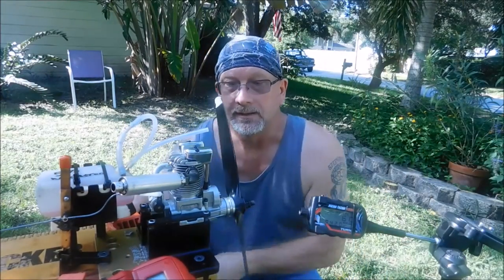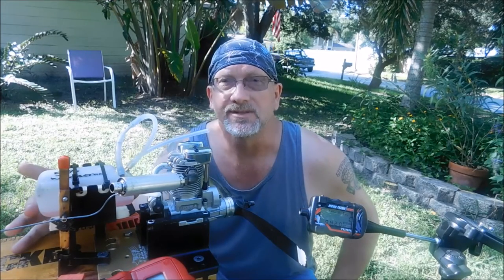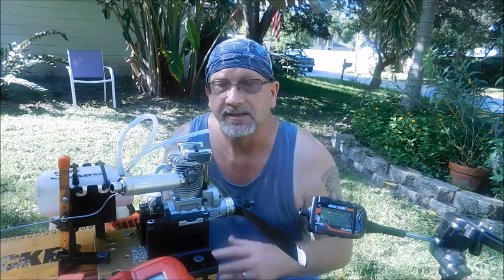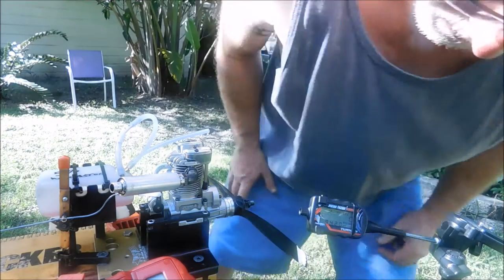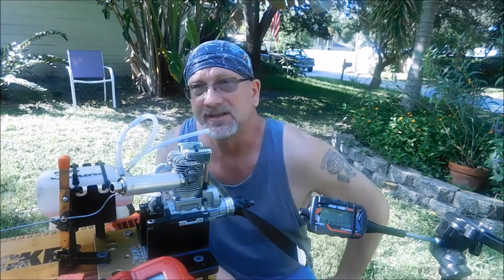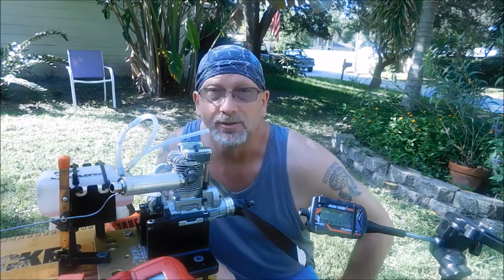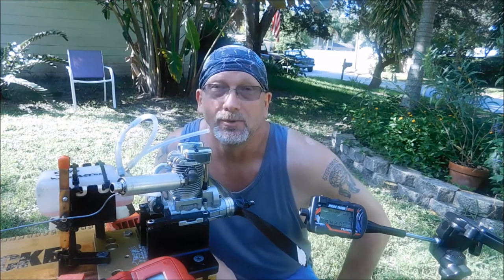Okay, now that's more like it. Saito FA-80 with an Enya number 3 plug, Morgan's 5% Omega with 4.8 ounces of castor oil added for a total lube content of 20%. Got it dialed in pretty nicely here. It looked like 9420 was the max it wanted to do, whereas the 91 would do over 10,000 still. And this one actually sounded a little bit happier doing it than the 91 did. There you have it. Pretty nice running engines.